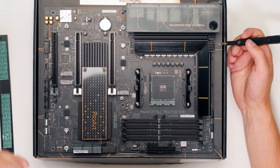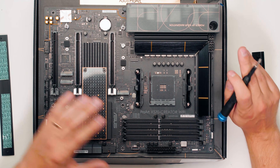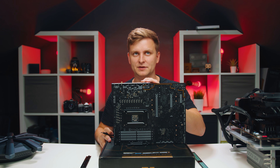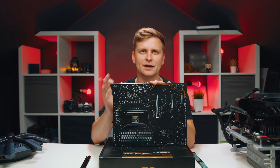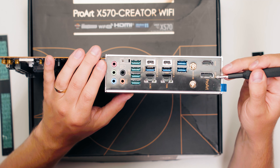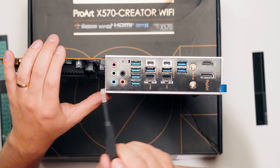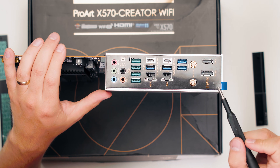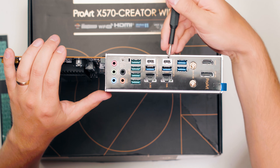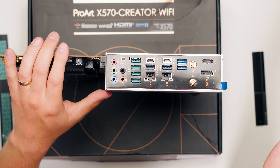You've got your CPU power connector here - this is 8+4, so there's plenty of power for anything on this socket including overclocking. The most exciting thing is the back panel. On the top we have HDMI and DP-in. The DP-in is what the included DisplayPort cable is for: it comes from your GPU into this DP-in, and then the video signal comes out through the USB-C ports that are also Thunderbolt 4 compatible.